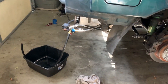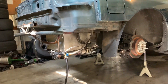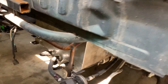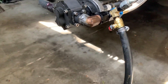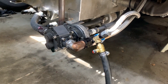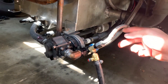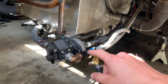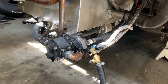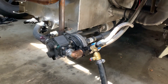Little upskirt shot here — something you don't usually get to see on my car. Bumper's off to work on a few things. I've been changing fuel back and forth at the track, so M1 for safety factor with no intercooler. Now with the intercooler I'm still going to try M1. I was just pulling this off — this is the priming pump feed into here — and I'd just pull this off and dump the fuel, then swap to M1, or after the track turn on the priming pump and dump it and put pump gas back in.